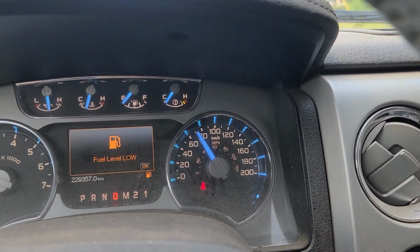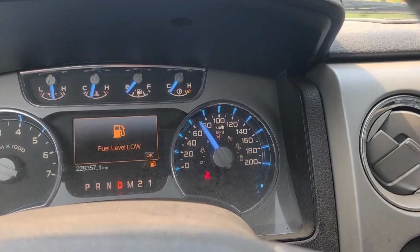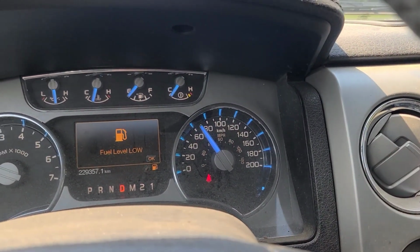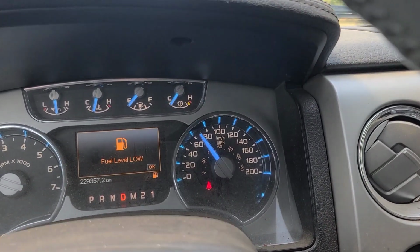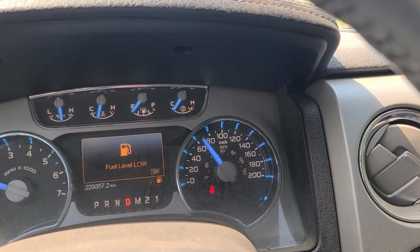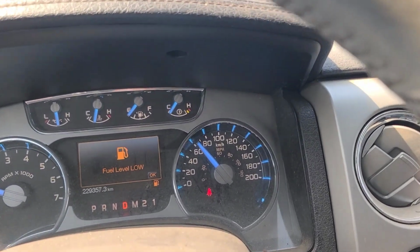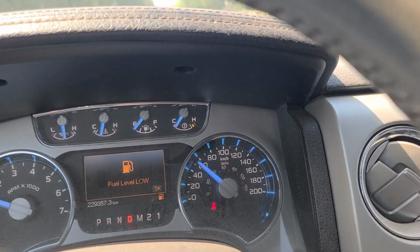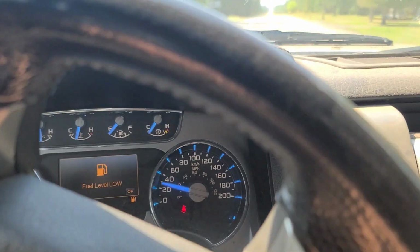The noise diminishes on deceleration. On coast, it's back again. But in neutral, with light throttle input, it's good. So I think the hanger bearing is gone or something has failed in the drive shaft. We're going to bring it back in. I'm afraid to drive this thing too far for running out of fuel or blowing up, one or the other.